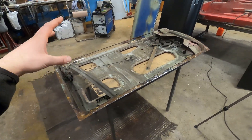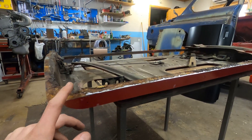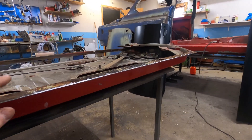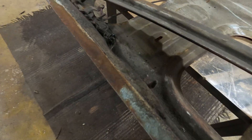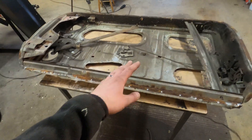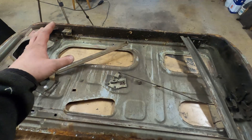It's finally removed and I had a little bit of luck — I found that they had made two pieces of metal, like the door skin and then a reinforcement for the door, and they had welded them together down here. I found the weld, ground it down a bit, then took the blade and hammer and went all the way through. I still have the piece to fit the new door skin to, I just need to clean it up. Up here where there hadn't been any rust repair, we can see how much rust was hiding between the metals, especially next to the window. I'll have to remove all the surface rust, put some primer on it, and still be able to weld the new door skin on. I'll also take time to clean everything up inside since I won't have the opportunity to clean the inside of the door again once the new skin is on.